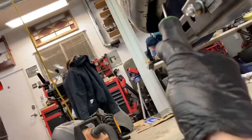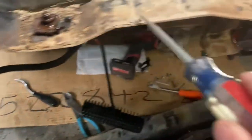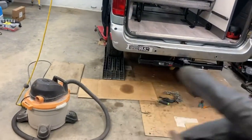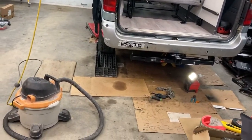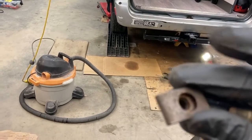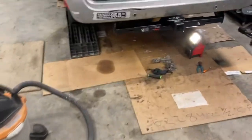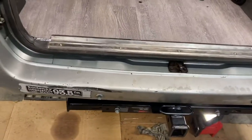There were five of them, then three on the bottom — one here, one in the center, one at the end — eight total. I cracked each and every one of them; each one just snapped out the plastic on the bumper, so everywhere it was bolted on is now broken. If you take the whole bumper off first, you can remove the sub-assembly without damaging it. You could spray some PB Blaster in there and slowly crank them out more carefully — but I unfortunately did not do that.